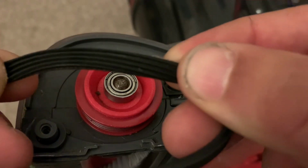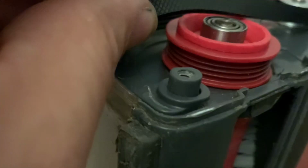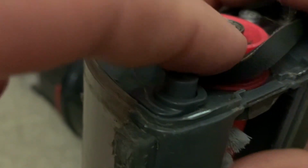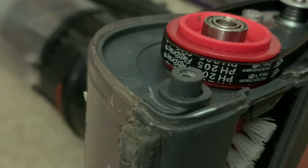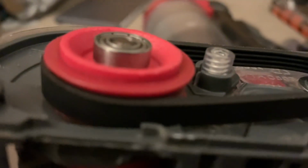Some have a toothed belt, this one has a grooved one. Please check yours before buying on the link in the description. You put it around the motor first and then put it around the brush bar end. Carefully holding everything in place, you can now turn the brush bar with your thumb or any means possible and it will all kind of fit together. Don't worry, the belt will be a little bit slack for now, but it just needs to look like this.